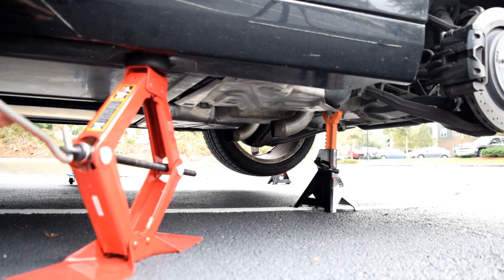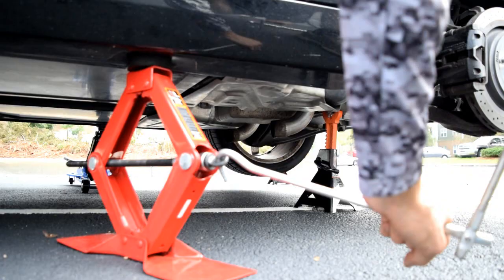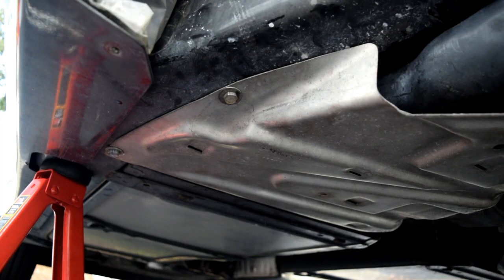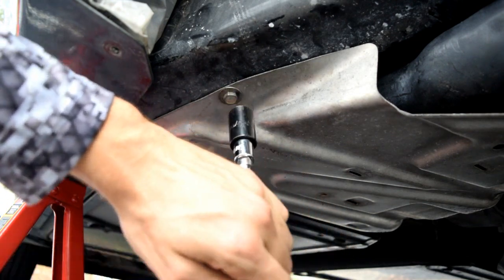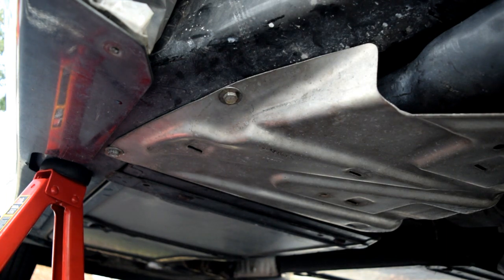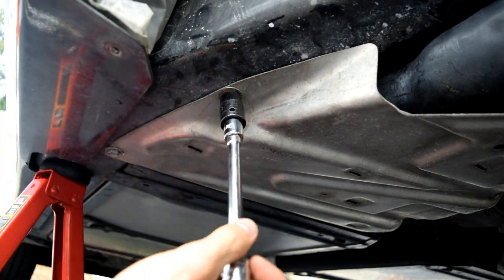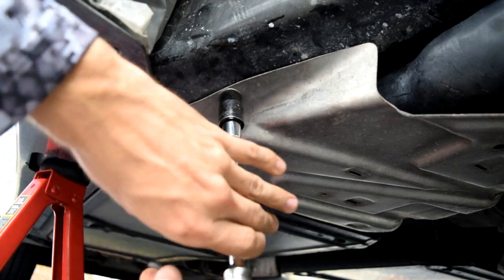Okay, I can feel the jack is now free from the car. I'm just gonna reorient it the other way and then re-jack it up. Next up, we're gonna do the 5 15-millimeter bolts that hold in the aluminum gas tank. Whoops, excuse me. That is not 15, that's 13. The 5 13-millimeter bolts that hold in the gas tank tray or whatever it's called, gas tank tray.